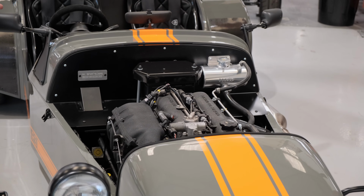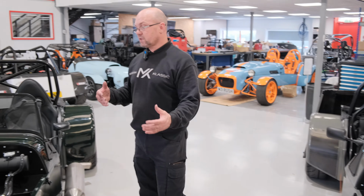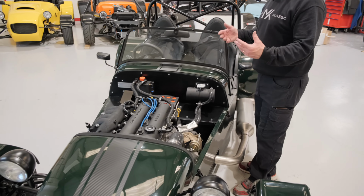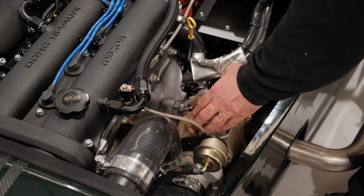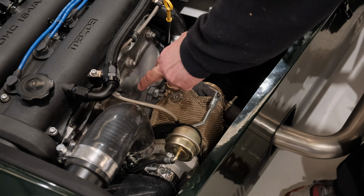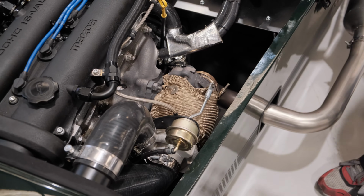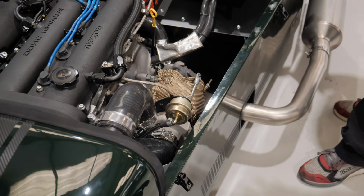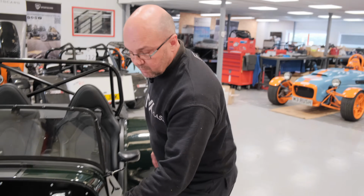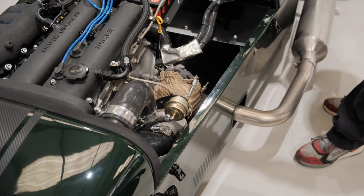So we've got this one here, which is the 140 to 150 horsepower engine, depending which series you go for. You can then venture down this particular route, which is like the 250 plus grade, which is then turbocharging your vehicle, which we use this manifold, which is a turbo manifold, bolts directly, and you have a TD04 turbo there, which is off of a Subaru Impreza based vehicle. We do a 13T, or you can go for the bigger 19T, which would need forged internals.